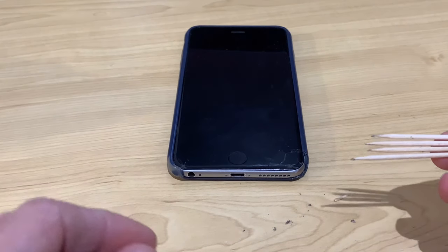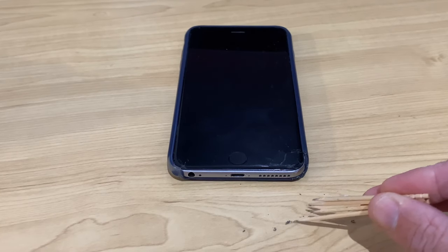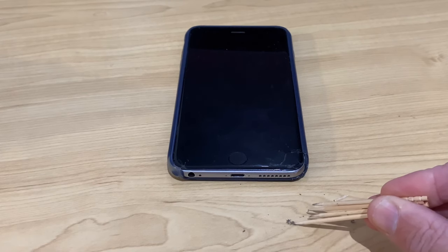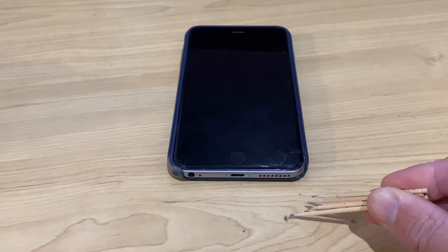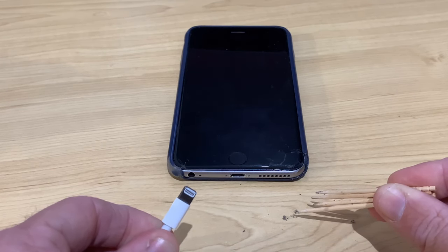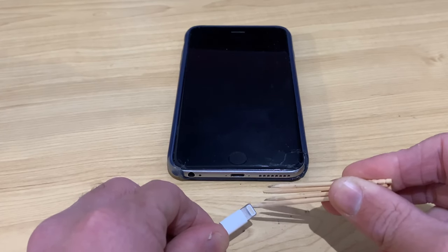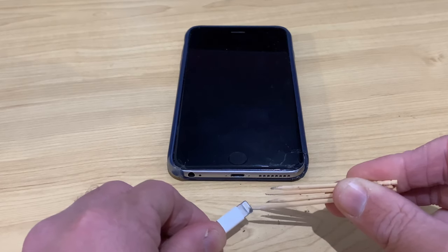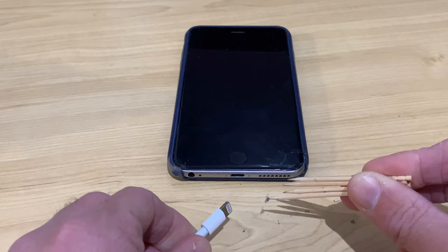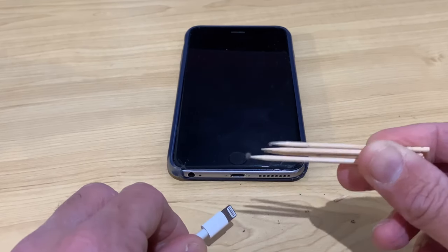So after about five minutes of digging around there, you can see how dirty the ends of these toothpicks are. And look at these piles of crud that I've got here — these are all big chunks of pocket lint and other bits and pieces that were caught in there. You can imagine that if you're trying to plug in something like a lightning cable or a USB mini, micro, or USB-C cable, and these are sitting on top or in your socket, it's going to stop the pins from actually connecting. And it's going to cause those problems like not connecting at all, or connecting and disconnecting because every time it moves around, a piece of crud is getting in the way.